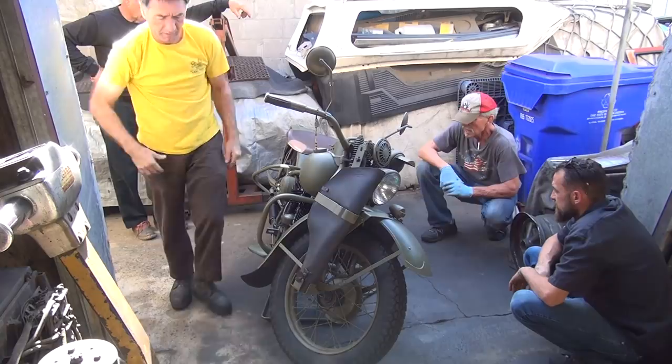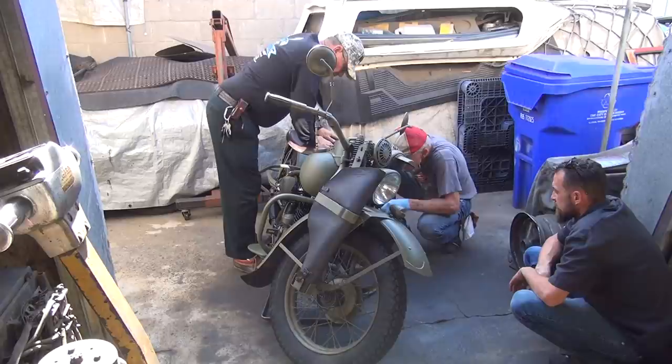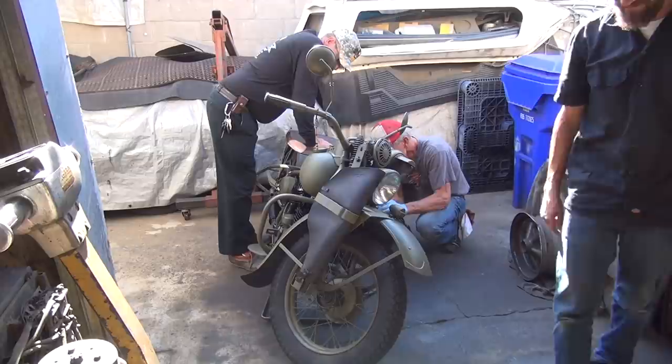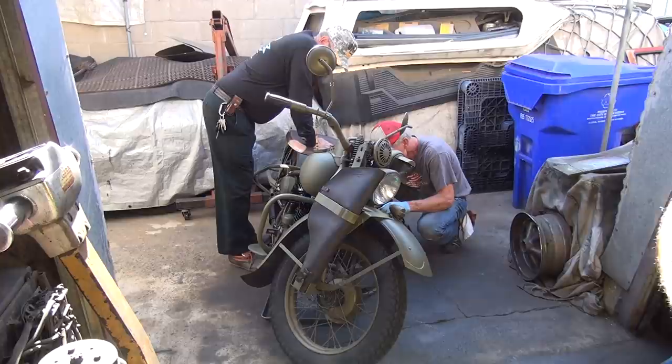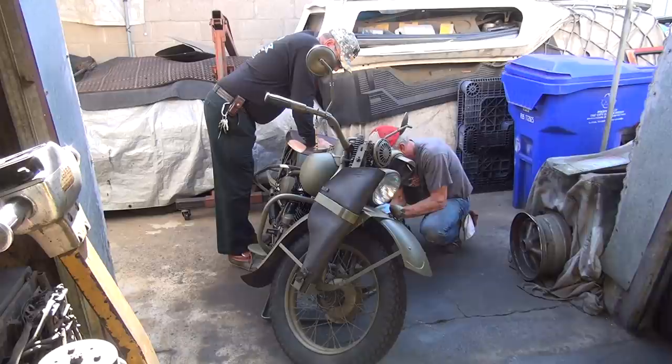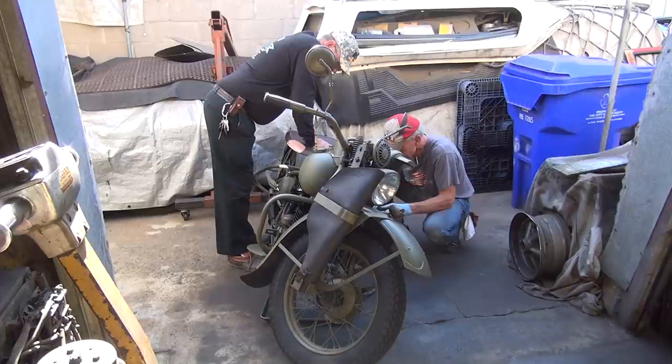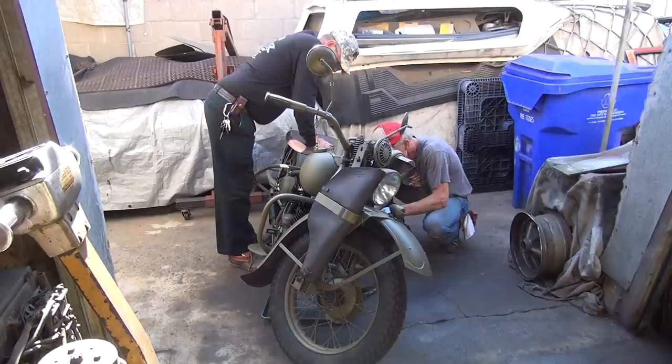This air stack off. I don't see if there's any fuel in this motor. I think it should be pouring fuel out the exhaust as much as priming when you're on it. Yeah, it doesn't even smell like gas. I think there's almost none in there. The ignition timing sounds extremely retarded too, when it did run, kind of. But I don't know where they had it set.